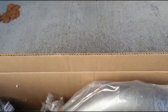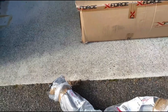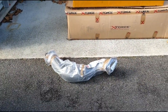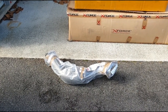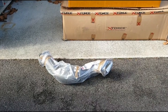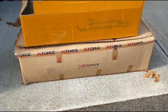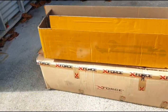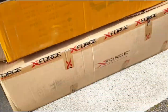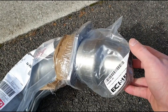This here is the Advanced headers dump pipe - four inch, way bigger than what we need - but I had a three and a half inch after the dump originally so I didn't want to go smaller than that anyway. I got that for a pretty good price, managed to get it for $350. To match it up with the exhaust system, we've got an adapter that we're going to weld in, with a flange down here, and that'll bring it down to three inch.